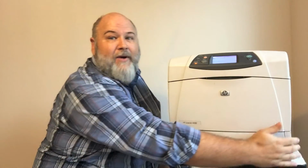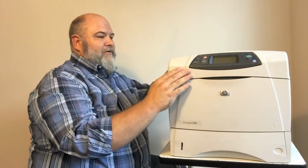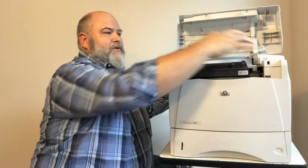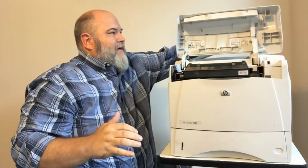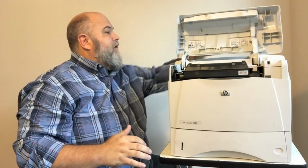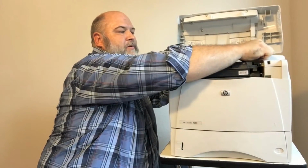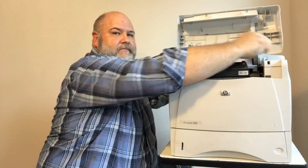So the first thing we're going to do is try to figure out what's going on with that fan, right? Okay, so we're going to turn the power off. Don't ever take it apart without the power off. Okay, you're going to remove 4 screws, 1, 2. Take off your back panel here. 3, 4. Disconnect your toner disengaging arm here.